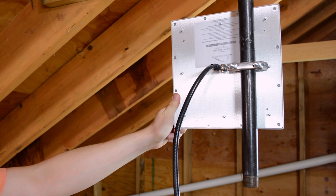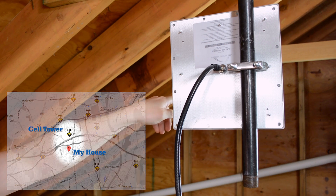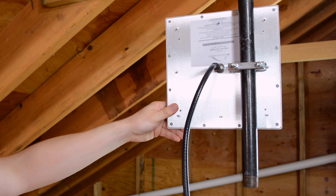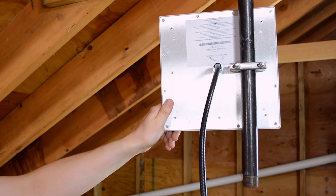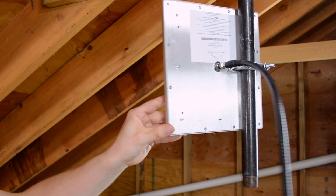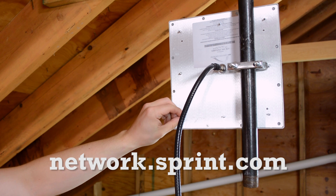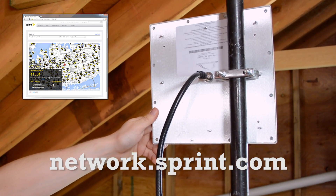This antenna is, of course, unidirectional — that means you have to point it as close as possible towards your nearest cell tower. I'm lucky in that my nearest cell tower is directly north of here, and that wall happens to face north, so as long as the antenna is parallel with that wall I'm pointing it pretty much directly at the cell tower. The other way to find where your best reception is, if you're not sure where your nearest cell tower is, is to just rotate the antenna in increments and see where you get your best signal strength. That can be quite time consuming with the Sprint device, because it takes about a minute — sometimes more, sometimes less — to update the signal strength; when I pointed it completely off-axis I didn't see a change for at least 45 seconds. The way I found my nearest cell tower was by going to Sprint's website, which shows a map of all the cell towers in your area, and with a compass or a little knowledge about which way your house faces, you can easily figure out where to point the antenna.